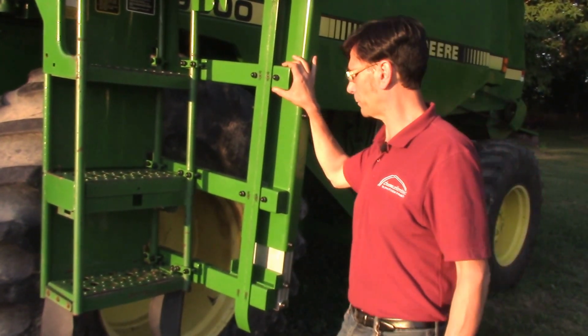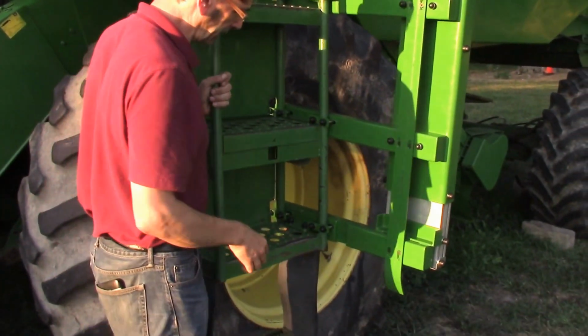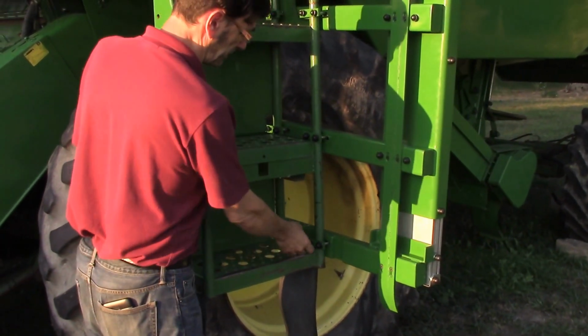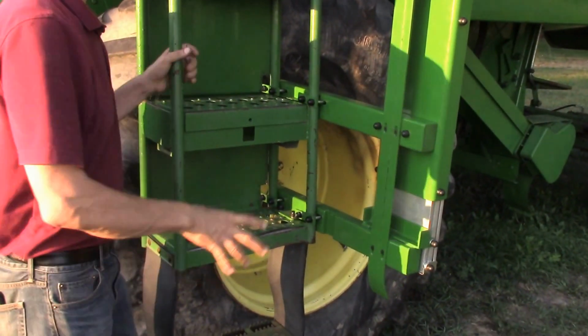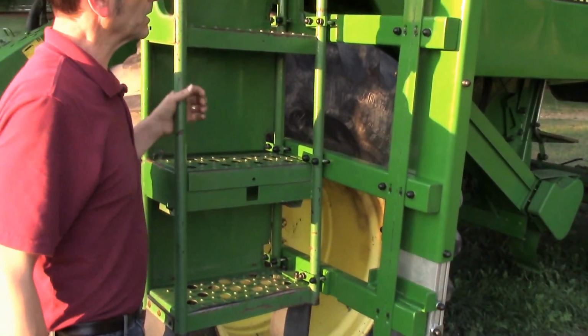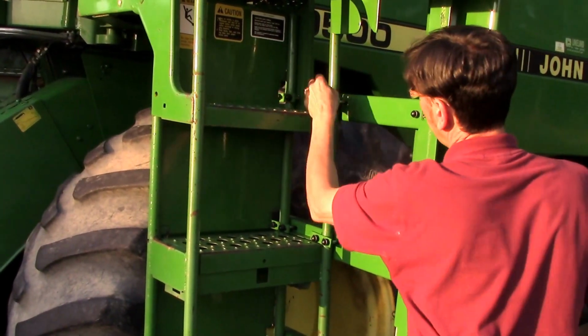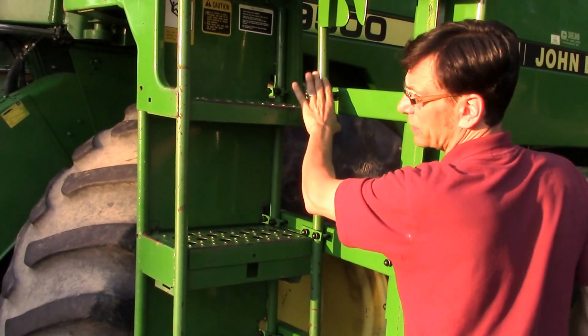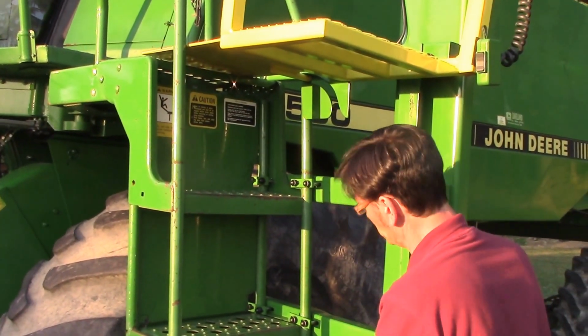Okay, so step one in your process is going to be the horizontal supports here. Again, these are specifically made for this application. We're going to mount the horizontal supports, but you're going to mount them nice and loose so that you've got some adjustability. And these go right here. You've got the bolts right here, and we've got some nice bolt caps, but you're not going to put those on at this point. Get them nice and loose, space them out as you see.